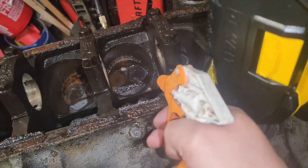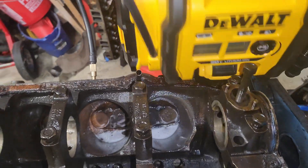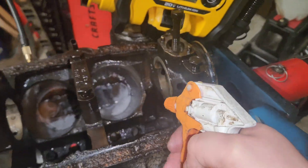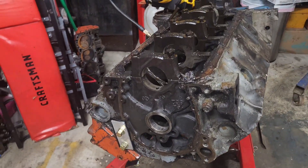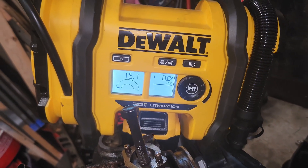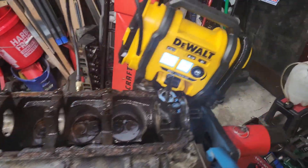Nothing there on any of the cylinders. The last one's going to be a little tricky because I've got to hold the camera at the same time. On that bank — the passenger side, right-hand bank — I'm just doing one last check before we unplug this thing. That chamber is holding 15.1 PSI — I'll call it 15, close enough, and that's plenty good. The cooling system only charges at 16, and if you want you can go to 20, but if it's holding 15 that well, it's going to hold 20 that well too. I'm going to call that side good to go.